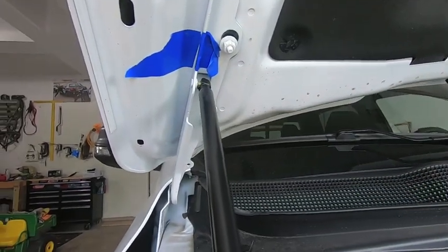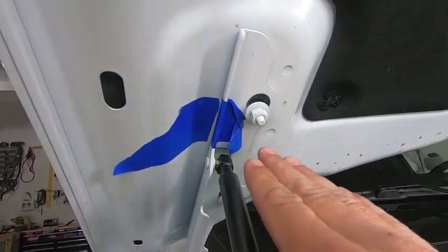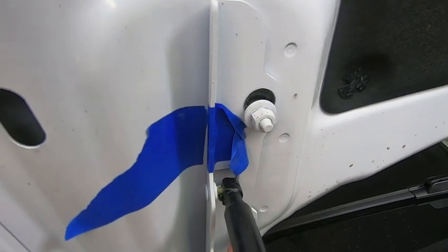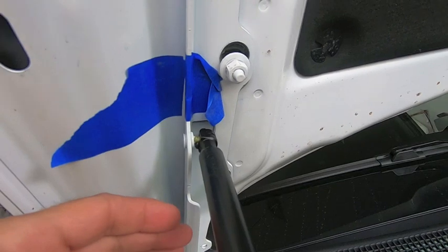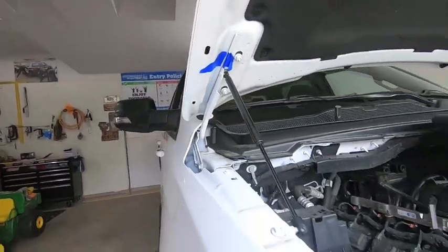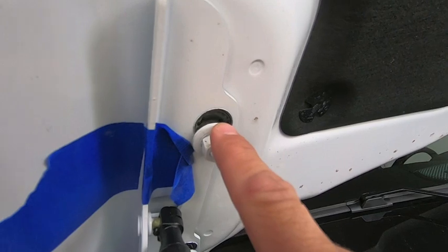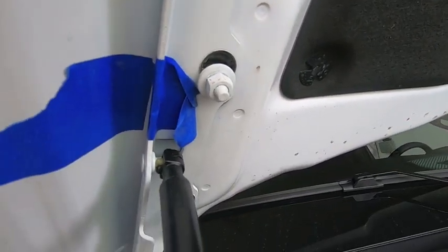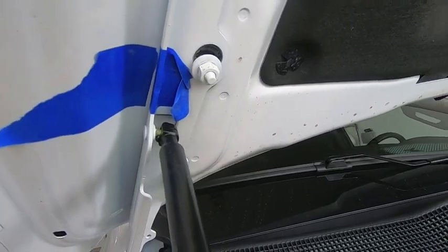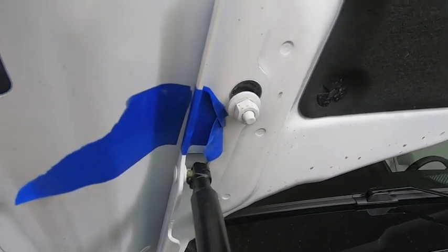I went ahead and put my tape on there and backed off the nuts. What you'll notice is that even though I'm only doing one side at a time, the hood is heavy enough to shift the whole hood down - it went down about a quarter inch. So after you put the bracket on and before you tighten everything down, pull the hood back up to realign everything, lining up the edges of the tape. Also check how it interferes with the seam - you want a nice even seam on both sides. Slip the Z-Roads bracket in from that side. The one with the Z-Roads emblem goes on the driver's side, the one without goes on the passenger side.